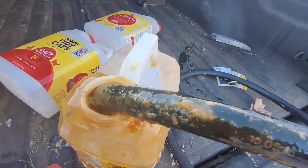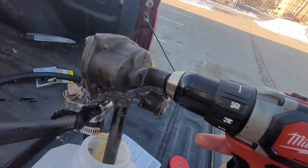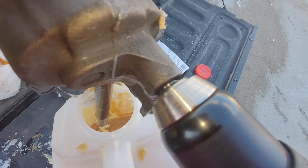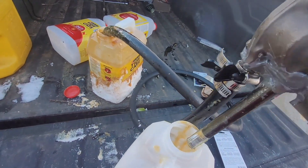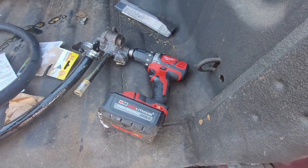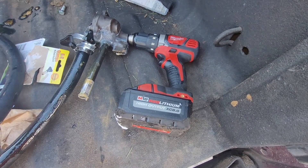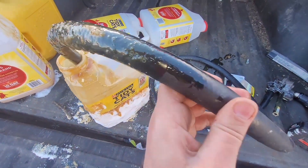Next day, I went and got some oil. I didn't have hose clamps — I kind of screwed myself there. But this is the pump, finished product. It's five-eighths heater hose on the outlet, and it's 16 degrees out today in Michigan. And it pumps like a champ. It's just — I don't know — about $3 for the pipe, $30 for the pump, $5 worth of JB Weld, and you've got a pump that moves 40 gallons a minute of absolute sludge oil. Look at that.